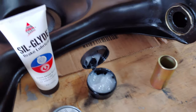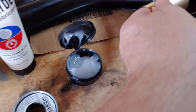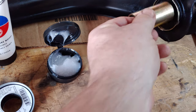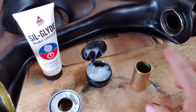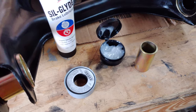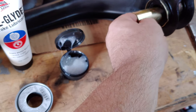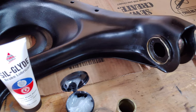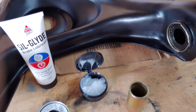What lubricant to use? We have two bearing surfaces that are going to be sliding that need to be lubricated. The polyurethane — it's metal right there — this is going to spin. And then the shaft within this will spin. The original bushings that came on the truck, the ends of this are serrated; some of the aftermarket ones are as well. The idea is to limit the shaft moving inside of this, and to keep all of the action happening between the rubber and the bushing. That's wishful thinking — you're going to have articulation on both of them. The only thing you want to avoid is this shell needs to be staked in place, and we want nothing moving there. That will wear out in short order.